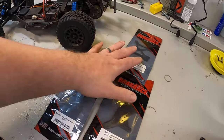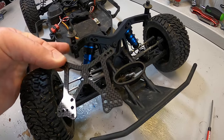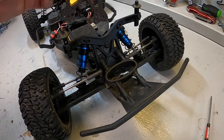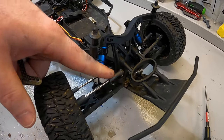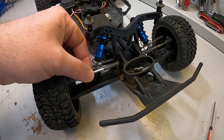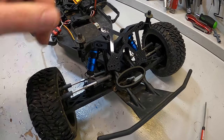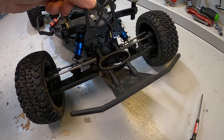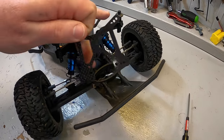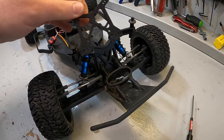First thing, as a good example: front and rear carbon fiber shock towers. Starting up here on the front of the truck, in general the front shock tower does match the new one — we have the same rough mounting locations for the front shocks. The front turnbuckles have a little kick-out where they mount vertically, but there are holes so you can adjust and mount it sideways instead, so it looks like that will all work. The front bumper mount is another question — on drag cars you don't run those very much, so we may end up getting rid of the front bumper mount.